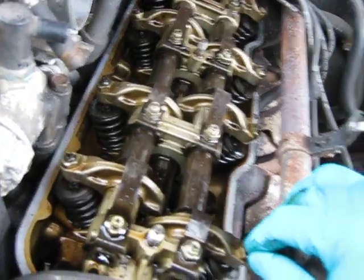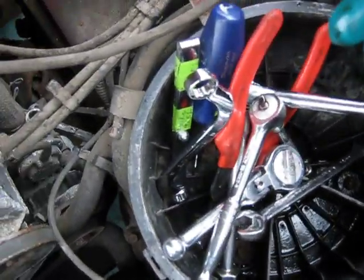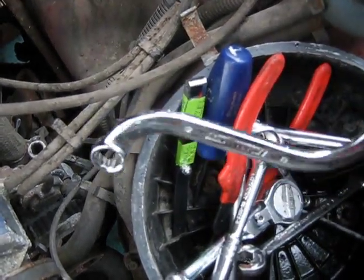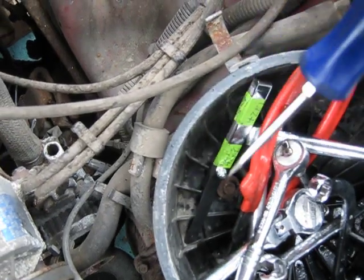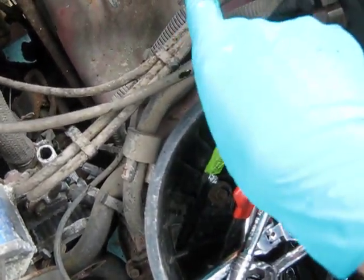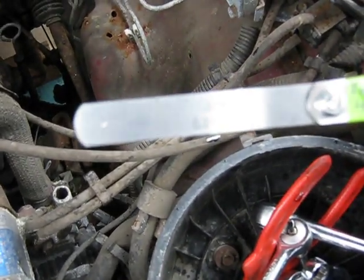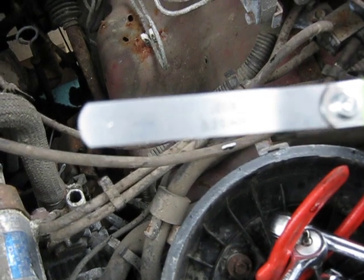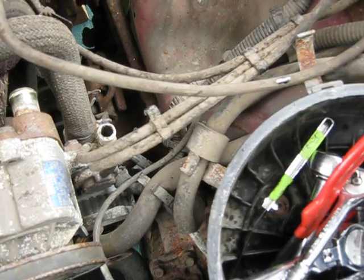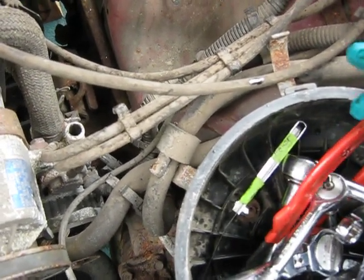I just finished checking with my feeler gauge. I've got my little setup here — my 12 mil wrench, and these little curved ones sure save me a lot of times. Got my flathead screwdriver and my feeler gauge. If you didn't catch the last video, that's 0.008 inches or 0.20 millimeters. So 0.20 is what I set at, and that is what the factory recommends. The Chilton's is actually 15-25 as we went over.